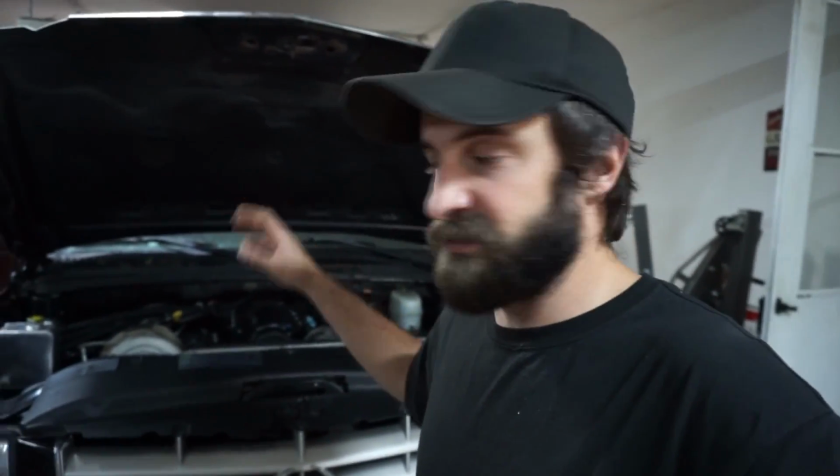And then I'll probably take it out during the week this week and test some of the launch control stuff. I'll try to see if I can get it to build like 6 to 8 pounds on the brake. Right now, the way it was set up, it was only building like 1 pound, but before it was building 6 before I did the boost controller changes. So I know I can do it, I just have to get it back there. Hopefully we can launch it on 6 pounds and then run like 18 to 20 at the track. That'd be kind of cool.